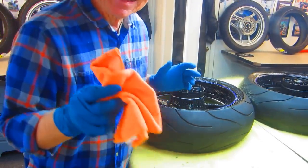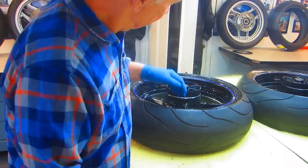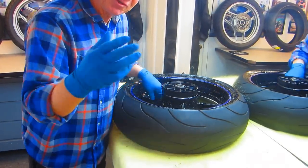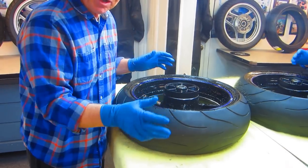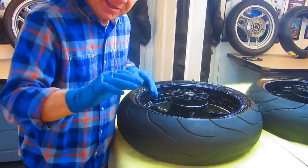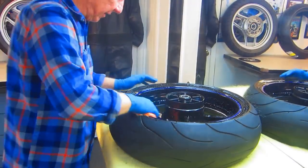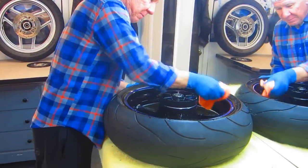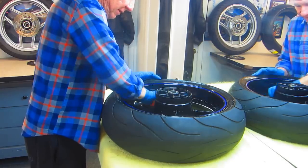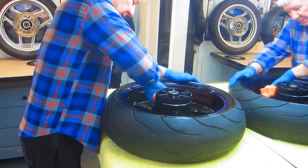In this case we're going to be spending a lot of hours, maybe several days, cleaning up. What I want to do is where the spokes are — this part of the wheel is shiny. I've polished that, but you can't polish the spokes because they're a casting. So just like on the Yamaha wheels, the RD wheels, and some of the other ones, I want to take that casting, sand it, grind it, polish it to where it's smooth, and then put a really nice finish on it. I've found Simple Green — I'm not even going to take the tire off because what I'm going to do is steam clean this wheel, and the steam will heat the tire and make getting the tire off just a little bit easier.